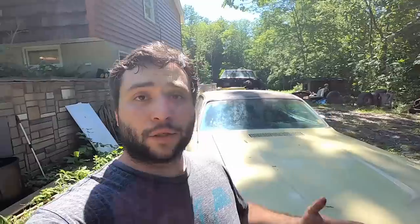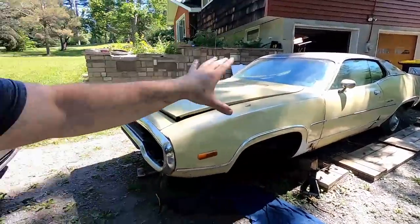Learning from this - just because you have a bearing inside of an engine, you shouldn't rely on it. That's what I've learned. Next: mic it, get the right bearings, put it back together. And we have a little bit of cleaning - I've been talking to a few people about how we can actually clean this block without fully disassembling it, which sounds insane. I've had a lot of you guys emailing me about how we can make this right, because this whole build is all about experimenting - not only for myself but for you guys as well.